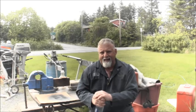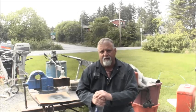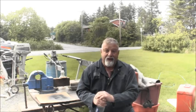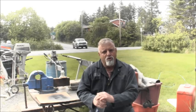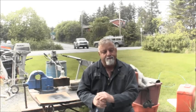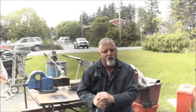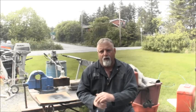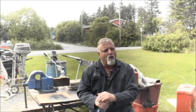So in my last video, I did a little presentation about these Yamahas, roughly 2002 up to 2005 when they changed it. Instead of an electric choke or a manual choke, they put an electrothermal fuel enrichment unit. I showed in that last video they're junk, and this little window of four stroke 9.9 and 15 horsepower Yamahas are cold starting badly because of it.